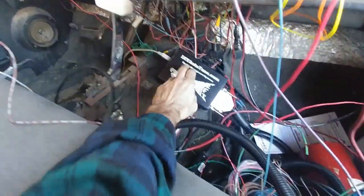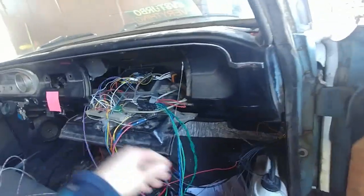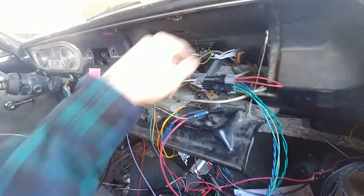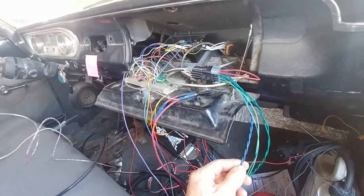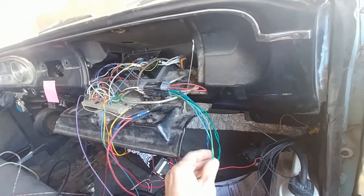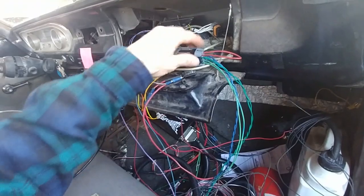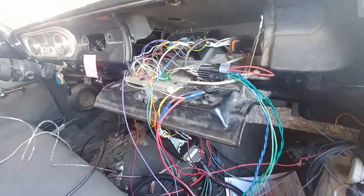The plan is the MS3 box - I have the expansion harness and main harness broken out all the way up to this stuff here. This is the actual connector running down to the transmission through the hump, down to the connector on the tranny. 12 volts in - originally I brought it in, looped it through a diode and brought it back out, so I'm doing the same here. Blue I believe is EPC, green is torque converter lockup, and light green and light green with blue stripe are nitrous one and nitrous two - which are also shift solenoid one and shift solenoid two.